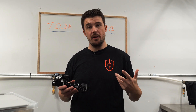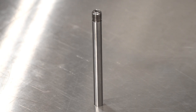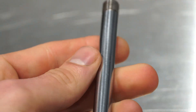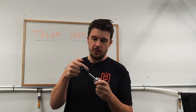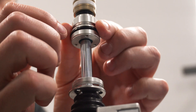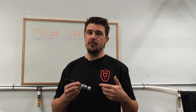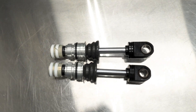We're going to start off with the damper shaft — a really straightforward part but surprisingly important. We use a 10 millimeter diameter hard chrome plated and microfinished solid steel shaft. When I say solid, it's drilled part way through for weight reduction, but it does not have a rebound adjuster or anything going through the end. The hard chrome plating and finishing is extremely straightforward. Over the years we've seen any number of alternative coatings and tested a few ourselves — none of them really went the distance as far as durability went, which made hard chrome plating a very easy choice.